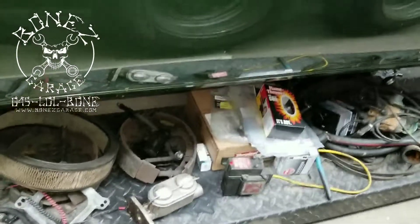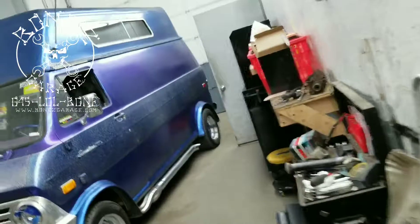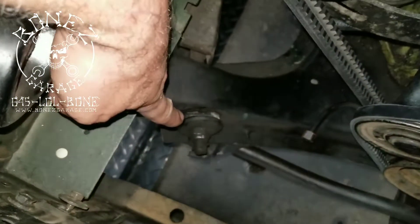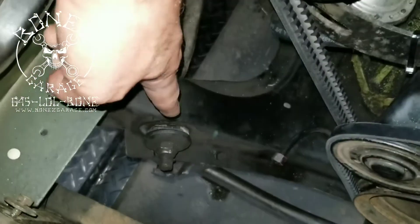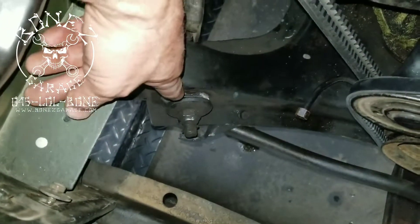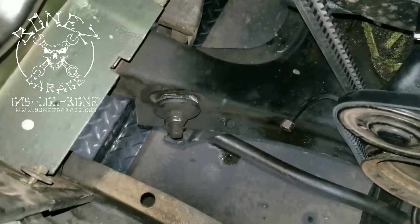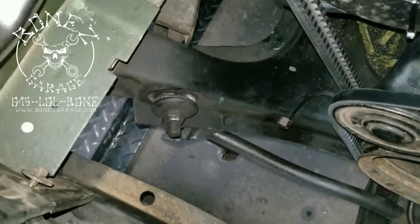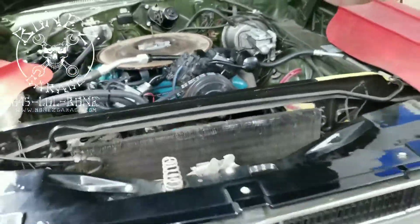There are some of the old parts that came out of this car — there are more under there, but I figured I'd show you a few and explain why we replace what we replace. One thing I really would have liked to replace is these lower control arm struts — they go from here all the way back to the lower control arm and keep it from going back and forth. The rubber is starting to go bad, but if we do that we have to get into everything else, so the customer said to leave it for now. Come winter, he'll bring it back and we'll replace all the suspension rubbers front and rear.